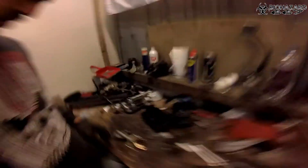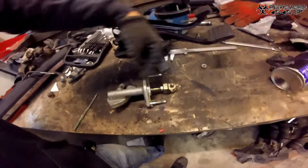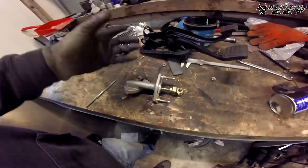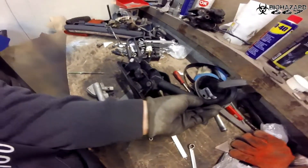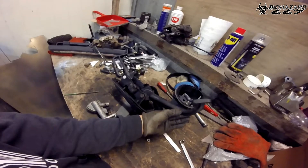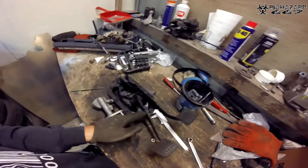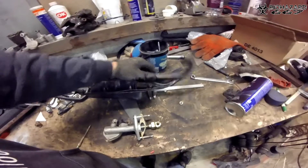The first thing you need to know is that on the cylinder it goes inside about 23.5 mm when you push the clutch. So I have to find a place. This is the correct position for the pedal — when you go down it is acceptable to have 24 mm of play. So I can move it and place it over here, here, or here. It needs to feel good.